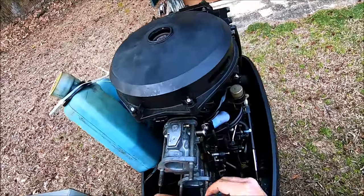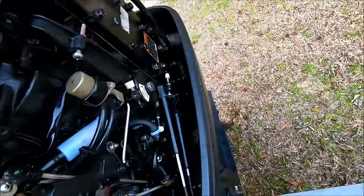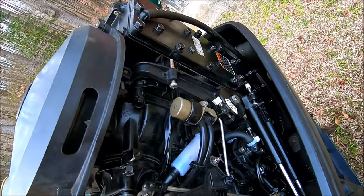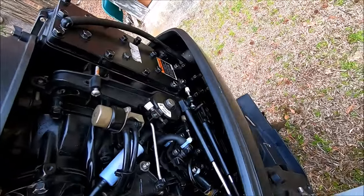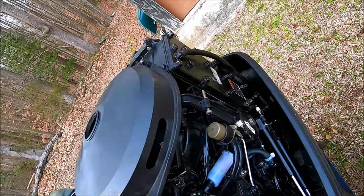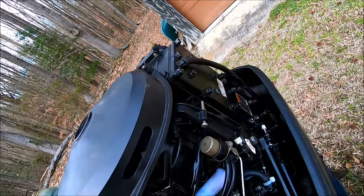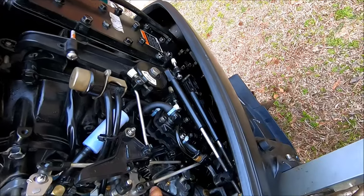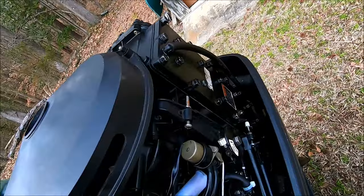Take the gaskets off the front. You have your tie wraps here, so you have to cut them so you can pull your carburetors off. You want to mark them — you do not want to get these mixed up, because they have specific positions where they go on the motor block where they bolt up to your reed blocks. So mark them and then we'll pull the carburetors off. Get your little cutters in there to cut these tie wraps.